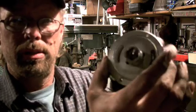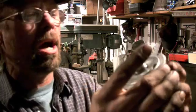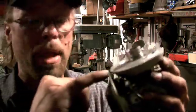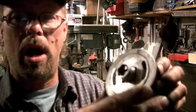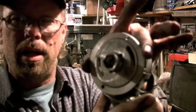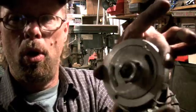See how that works? It was a lot of machining, a lot of timing it out and stuff. I've got like 10 thousandths. Oh boy, I take that back. It's more like 25 thousandths edge here. This sticks out a little bit farther, so as this cap here tightens up against the cam belt cover, it'll hold it solid.